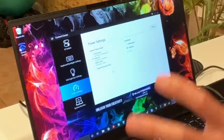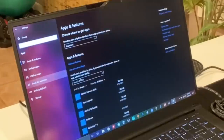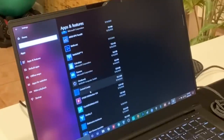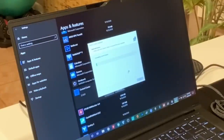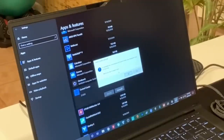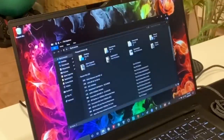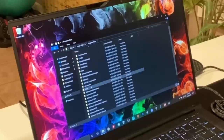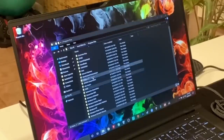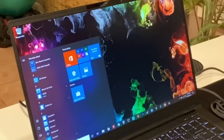What you're going to want to do when you get the new control center is uninstall the control center. But there's still one more thing you're going to want to do. Click Install. Now it says Restart Now — click No. You still need to delete a file, so we'll do that first before we restart. Go into Your PC, go into Program Files (not the x86), and find the one that says OEM — that's just the control center and it saves all your settings. We need to get rid of this. Clear the recycle bin, then reboot.